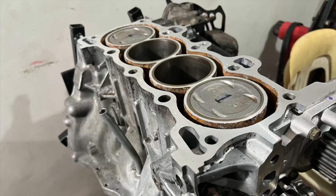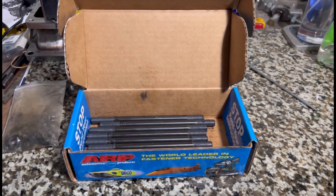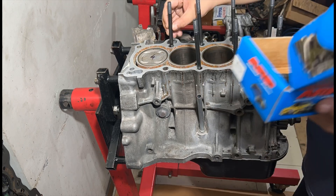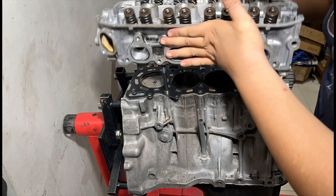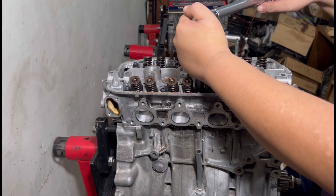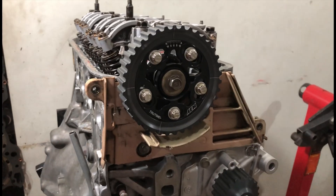Last episode we finished the block, OEM water pump, and all the good stuff - even the head is all done. Now we're going to install the ARP head studs, genuine AEM cam gear. We pre-lubed the head studs and tightened them on the block hand tight to lubricate the bare threads. We drop in the head gasket, then the head, and of course all the torque sequence will be covered. We're finishing up the engine - let's go.